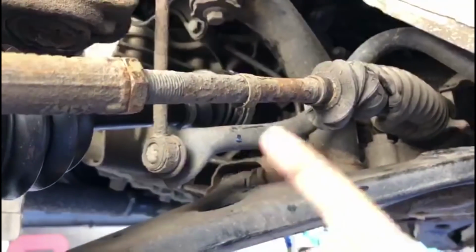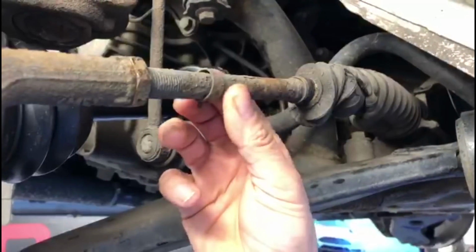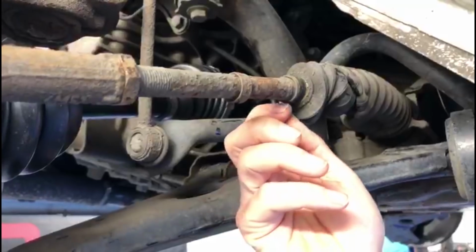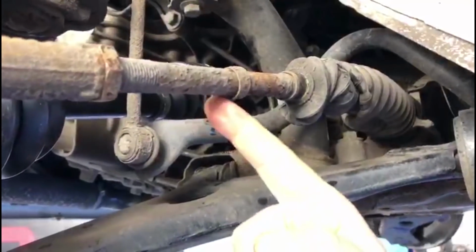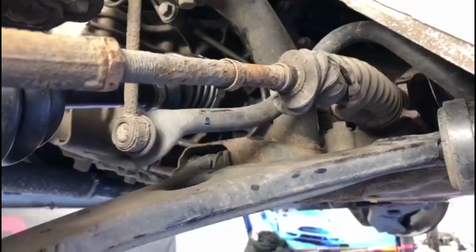So then he's obviously got it to move, but this has all come off, look, it's all sliding down to the retaining clip. And even though he's got the clip off, all he had to do was try and break the seal there and get that to move, spin inside there, a bit of lube, and then the rack boot would stay as it is.